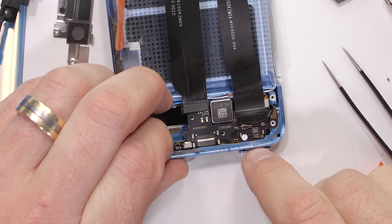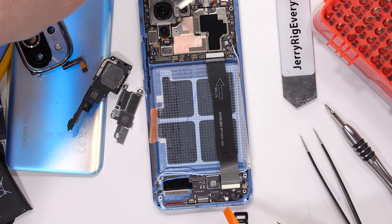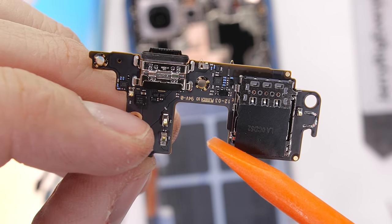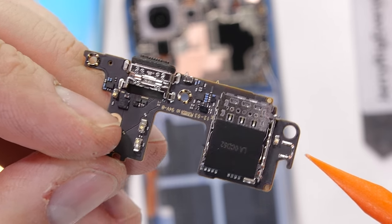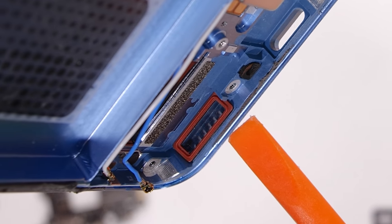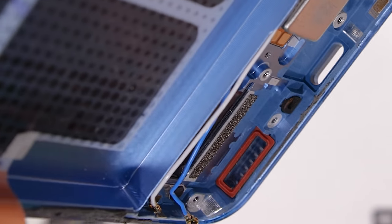I'll remove the dual SIM card tray along with a couple of extension ribbons. Then we have access to the charging port board with its white water damage indicator near the USB-C port, which also has a black rubber ring around the opening. That black rubber though isn't the only water protection — down here by the square vibrator and the speaker opening, we get another waterproof mesh with its own rubber seal. The Mi 11 might not have an official IP rating, but it still does have protection against water.